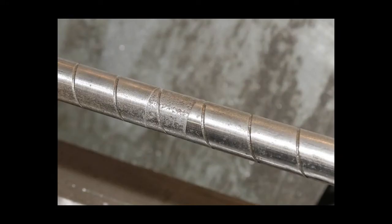And here you can see I was saying about an indent. It had been machined slightly in the centre of the shaft. And that corresponds to where the grease nipples are on the alloy sliders. So when you put grease in, it goes into that area that you can see reduced and goes along the spirals, and that's what lubricates. And as you can see, that also tracks all the rust.